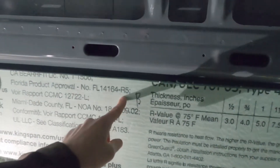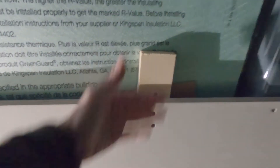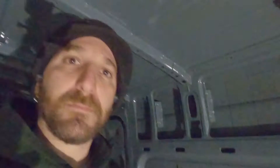You can see the foam back there — it's all cut pretty close to fit. I ran a bead of that construction adhesive in the corners and on the main supports, and a couple spots in between. Then once I shimmed it out — you can see all these shims in here — this gives me something to screw to when I put the next sheet of plywood on, since we're spanning about four feet right here. That also holds this tight against the glue, because this is bowed out on the outside of the van. If I just put it in there flat it wouldn't touch in the middle and wouldn't touch all that glue I put in. So this helps push it out to the glue. Now I'm going to throw on this side and get them the same height, then I just have to rip a two-foot piece for the top.